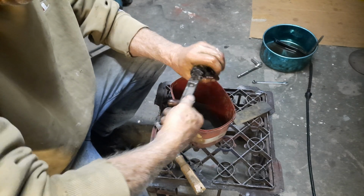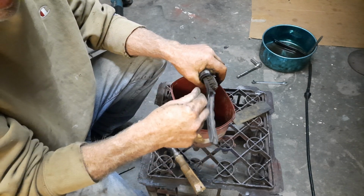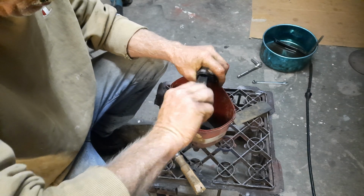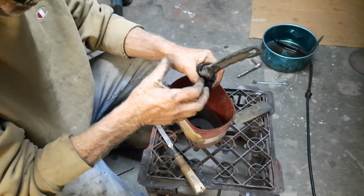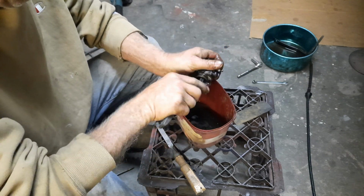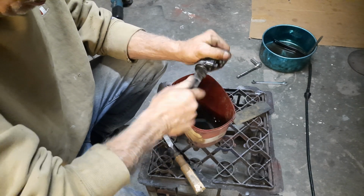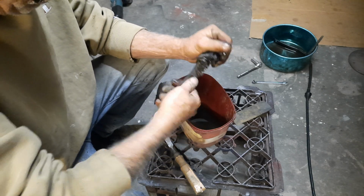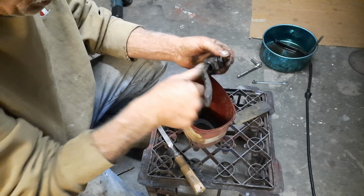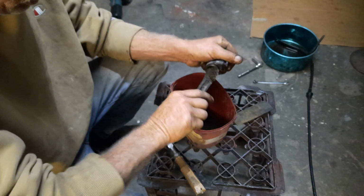Always when you're doing things like this, even with your emery, don't go this way, because if you put scratches in it, it's going to leak. By going this way, if you do happen to put a couple of score marks in it, they're less likely to leak because they're going around. Okay? And especially if you're scratching it off with a screwdriver or knife, don't go in and out, because if you happen to put scratches in it, you'll cause it to leak. So always go circular.